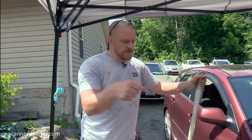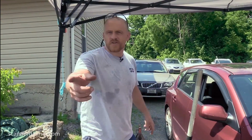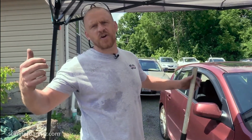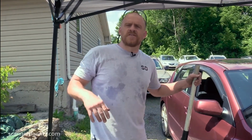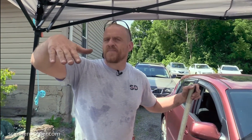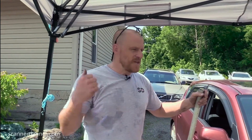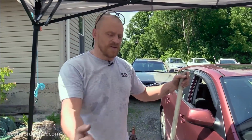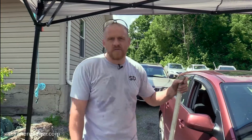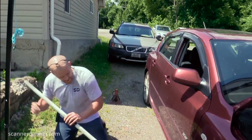Okay. So am I safe to lift this front wheel now? Yeah. Are my back wheels holding? Yeah. And we don't want to trust just pulling the brake on and saying, yeah, we're good. So here would be the scenario. You're broken down on the side of the road, flat tire. You need to change that front tire. You're on a slope, on a hill. People get killed all the time with this kind of thing. Pull the e-brake. Make sure it holds. Throw it in neutral. Make sure the e-brake is what's holding. Now go ahead and jack that front wheel off the ground, if it's a front drive. If it's rear drive, then you got to change up what you're doing.